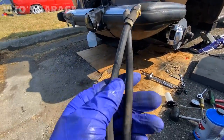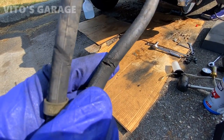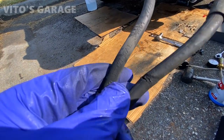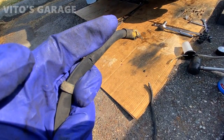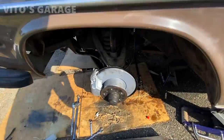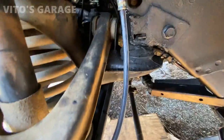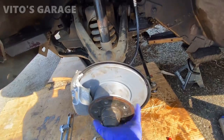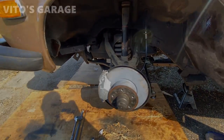This is why you need to watch out — look at how bad these old hoses were. That cracking and wear happened because the grommets were missing. That's a really big deal. Now those grommets are present. I still need to clean this area a bit — just finished bleeding the brakes — but everything is looking amazing. No leaks, calipers rebuilt. Great stuff.